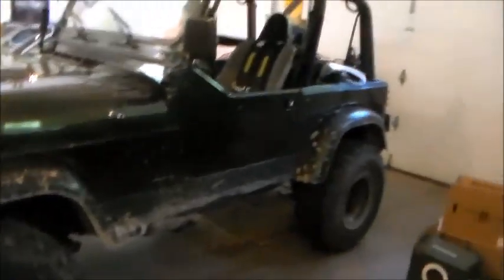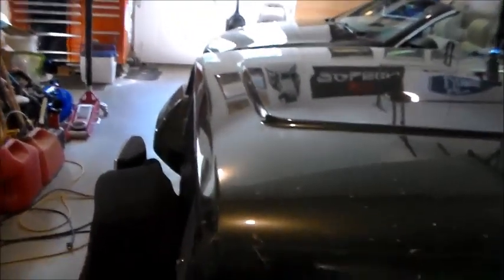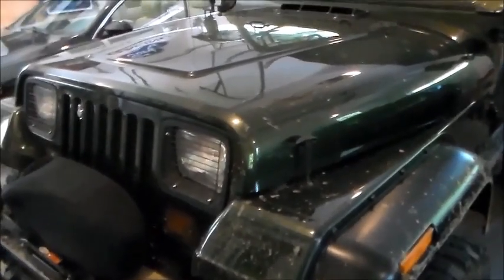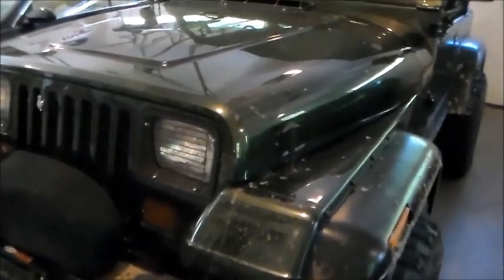From my foray out this weekend, I discovered a couple of things I really need to get. My Jeep is a five-speed and I had problems — when you're climbing a hill your foot is bouncing on the throttle and you need three feet: one on the clutch, one on the brake, one on the gas — problem is God only gave you two feet. So I did purchase a hand throttle; there's one company for about $36 that makes a good quality hand throttle. I will do an installation video on it.